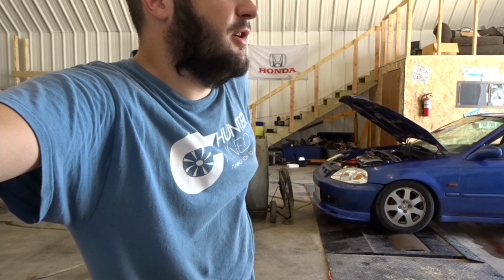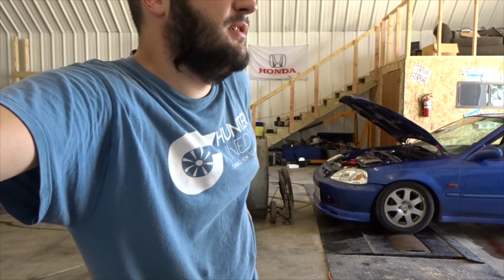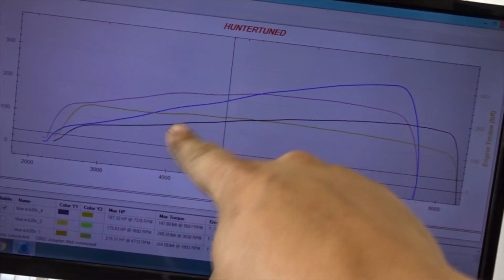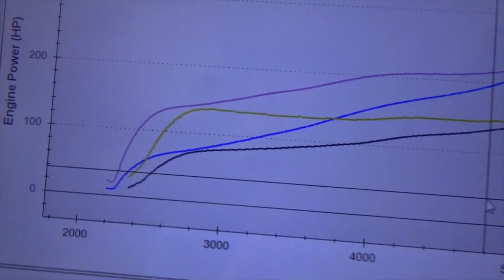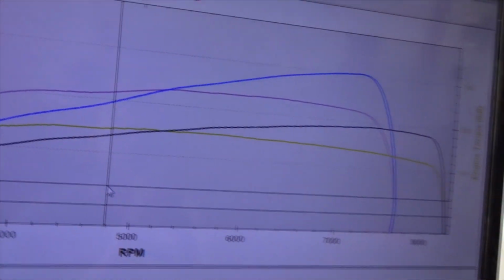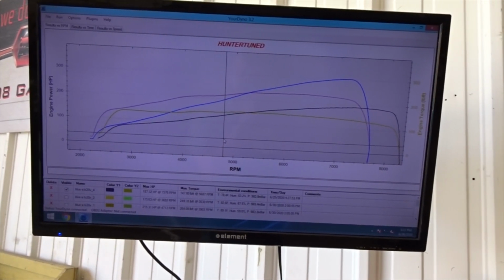We'll compare all motor to turbo now. And there's our difference. These two bottom lines are all motor, and that is turboed. You can see it picked up everywhere on the curve. There is not a spot it did not pick up power. So adding a turbo is always awesome. This turbo is sized very well for this kind of power. It is a little bit small, and it is one of them eBay units, so they don't really like running high boost, but less than 10 pounds like this thing's on, dialed.